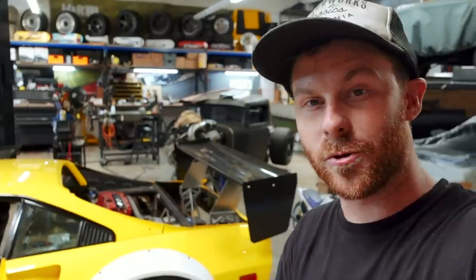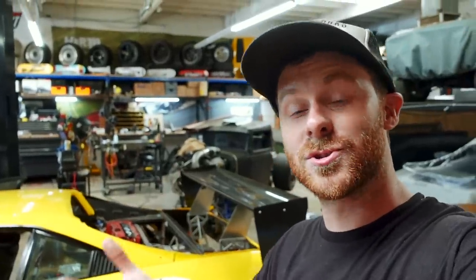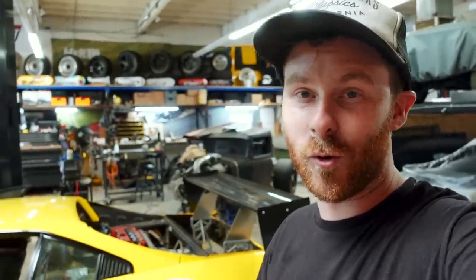I'm seeing room for improvement in the details already, but I'm really happy with how this mount turned out. It does a couple of important things: first, it gives the intercooler just a little bit of room for movement, which is important because the engine's going to move, the intercooler piping is going to move, and we need some compliance so that nothing is under stress and we don't wind up with aluminum fatiguing and cracking. But the mount's also really strong, so it should support the weight of the intercooler, which is good because the intercooler is completely full of water. On top of all that, I think it also looks really cool — it's an intricate piece, it looks handmade, and it's a cool focal point in the engine bay.